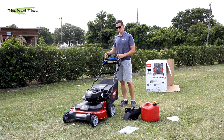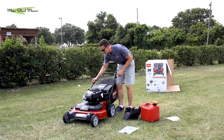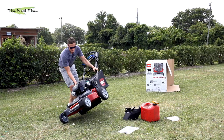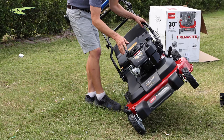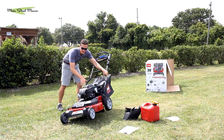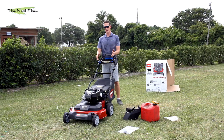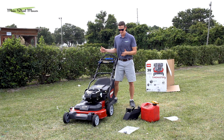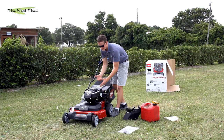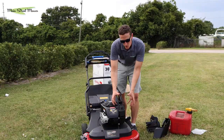To change the oil: crank the mower up, get it hot, then locate your oil dipstick right here and take it out. Have an oil pan ready and hold it under your dipstick fill tube, then tip the mower over. The general rule on all walk-behind mowers is that the dipstick is on the right side and you tip it to the right side. If you tip this mower to the left, oil from the engine seeps up into your air filter and carburetor — do it briefly and you'll have a lot of smoking and coughing; do it for a long time and your air filter will be covered in oil.